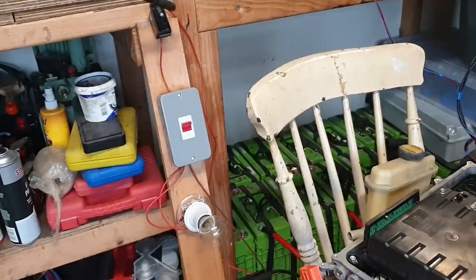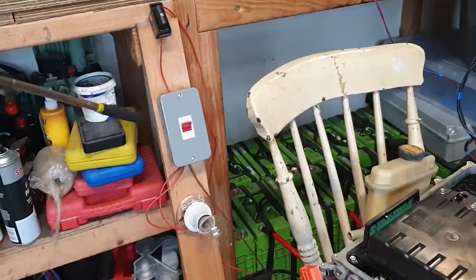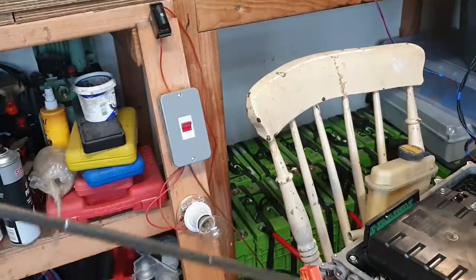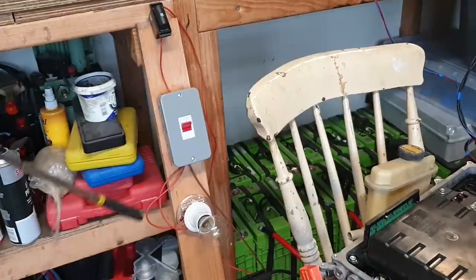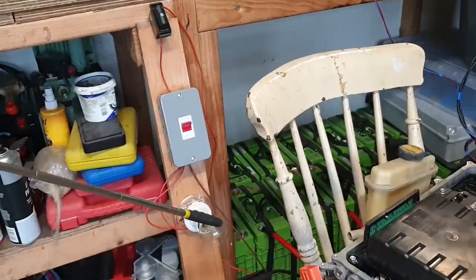And again, please note, folks, that a fuse in this case will not prevent damage to the inverter. It will fail eventually if we have something silly like a short circuit or something going on. Its job is to protect the wiring from getting too hot, not to protect your inverter electronics. That is what we use our little light bulb for.